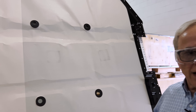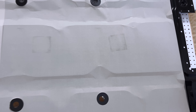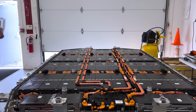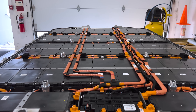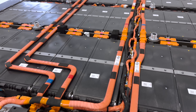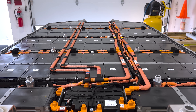We've taken the lid off the Kia EV9 battery pack. You can see there's a flame retardant material of some sort — we'll be able to disclose that at a later date. This serves as both a thermal insulator in the event of a thermal runaway and very likely an electrical insulator helpful in a crash situation. Looking at the pack itself, we have 38 individual modules all electrically tied together in series, each with four groups of three cells in parallel, totaling the advertised 100 kilowatt-hour capacity. The orange bus bars provide the series interconnection.